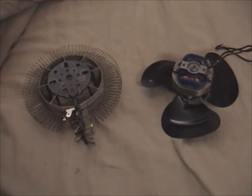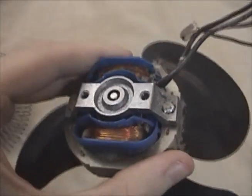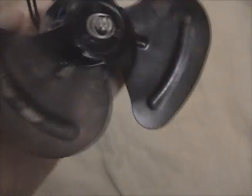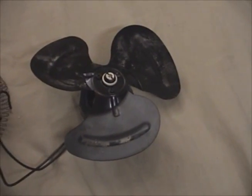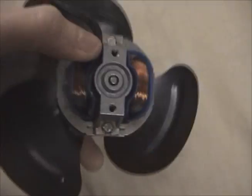Without too much fiddling, the heating coil and the fan come out - complete with moth carcass. We got a shaded pole motor, the internally wound type rather than the C-frame type with the external coil. It seems to be nice and lubricated too. I've been wanting to build a homemade miniature box fan using something like this motor, but I don't have a blade set and it's quite a few bucks to purchase one online, especially since I don't know if the shaft would fit. But here I've got the whole package already.